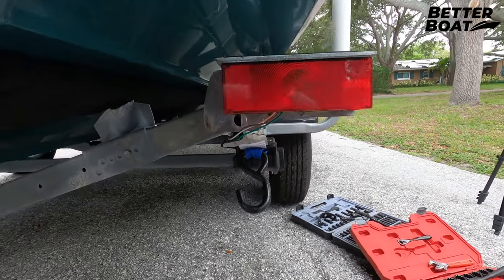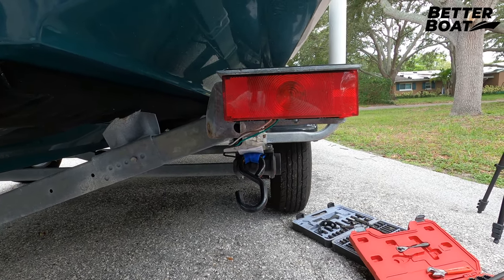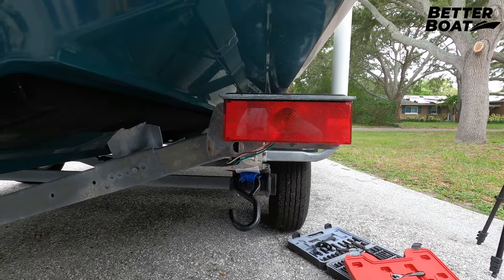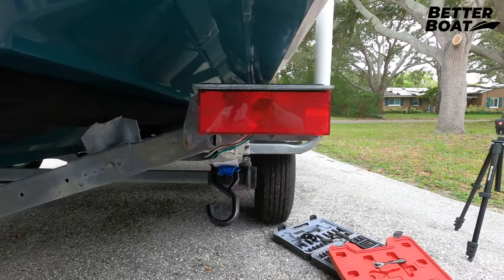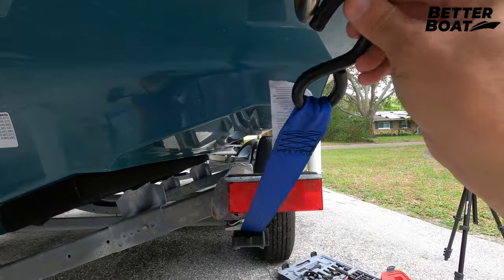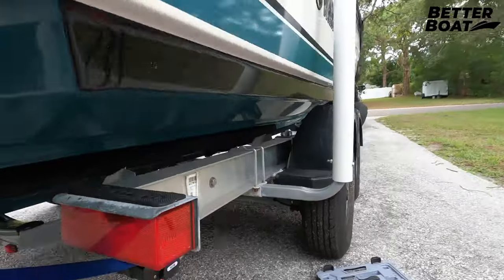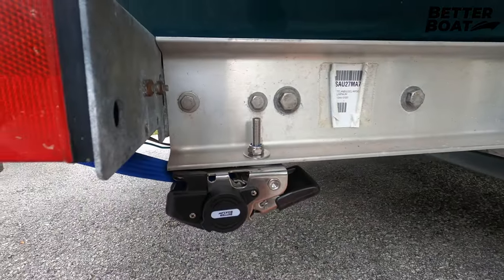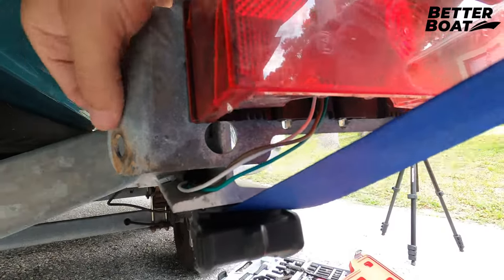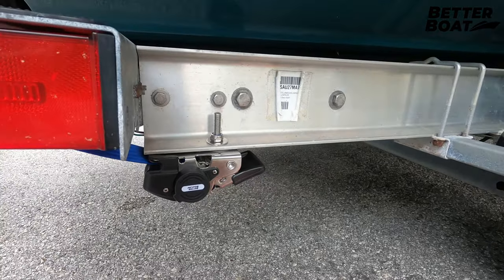So what I did is I actually mounted it underneath the trailer I-beam. And the reason I did this is because it has the most clearance there. And I also did it for the reason that when this load is applied, it is going to be straight back. It's going to come straight back to the actual hook point. So as I come, I am now straight in line with my hook point, and I have a strong mount. Whereas with the piece that they left for the straps, this tended to move and bend as you pulled and deformed, whereas this I-beam is not going to.